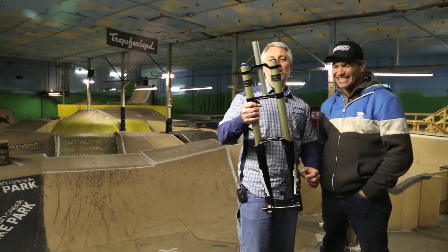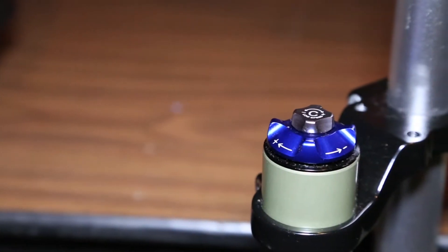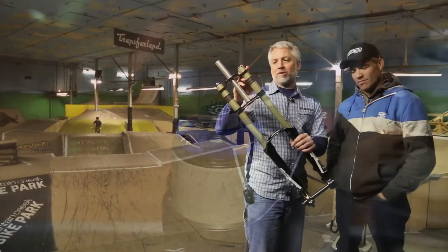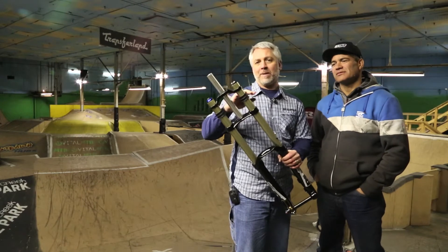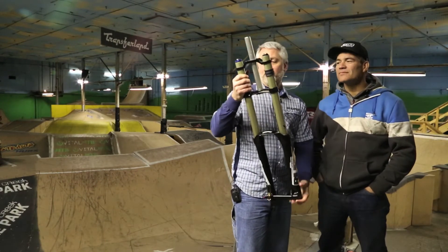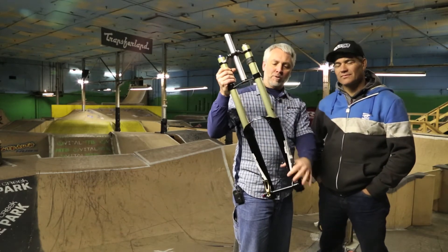This is the RUX. Let's go top down here. So up at the top, we'll look at the damper. We've got high and low speed compression adjustment. We have a spring system on here. This is an air spring, and it has five spacer systems, so you can actually change the progressivity — you can make it more linear or more progressive quite easily. We have 38mm butted stanchions on there, gold anodized.